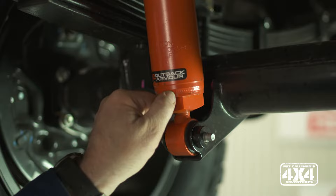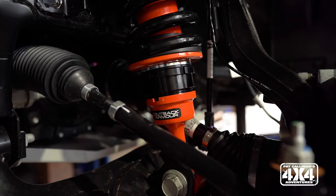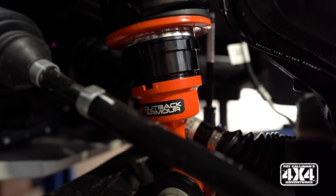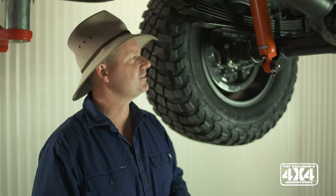You've got 20 forms of adjustability as you dial this little guy around. What that basically means is, if you are going into really harsh off-road conditions with lots of articulation, you want more control, so you will firm things up a little bit — this is a shock absorber that controls the spring, so you're actually after firmer shocks in those challenging conditions. But then you get back onto the highway and you just want a nice, comfortable, supple ride — that's when you dial it further around to the right and it will soften off nicely for you.